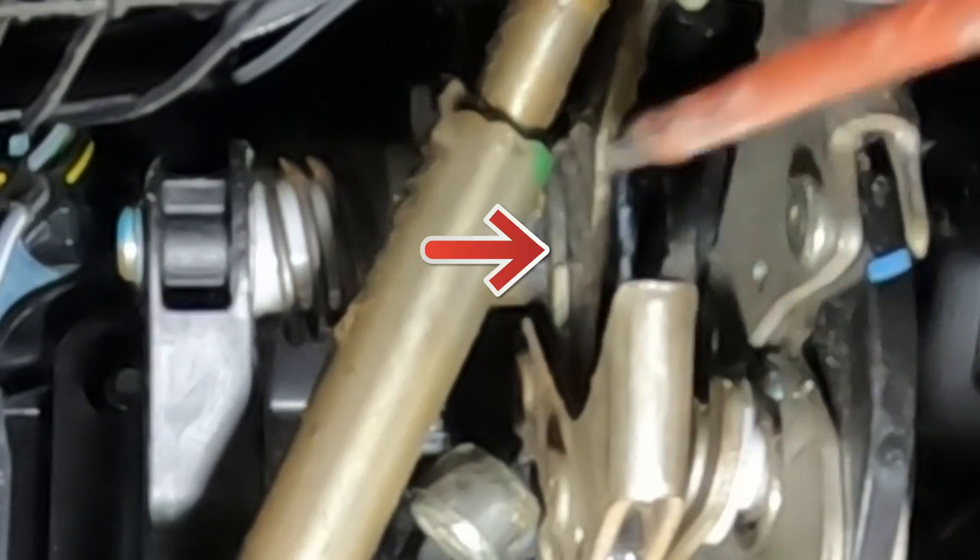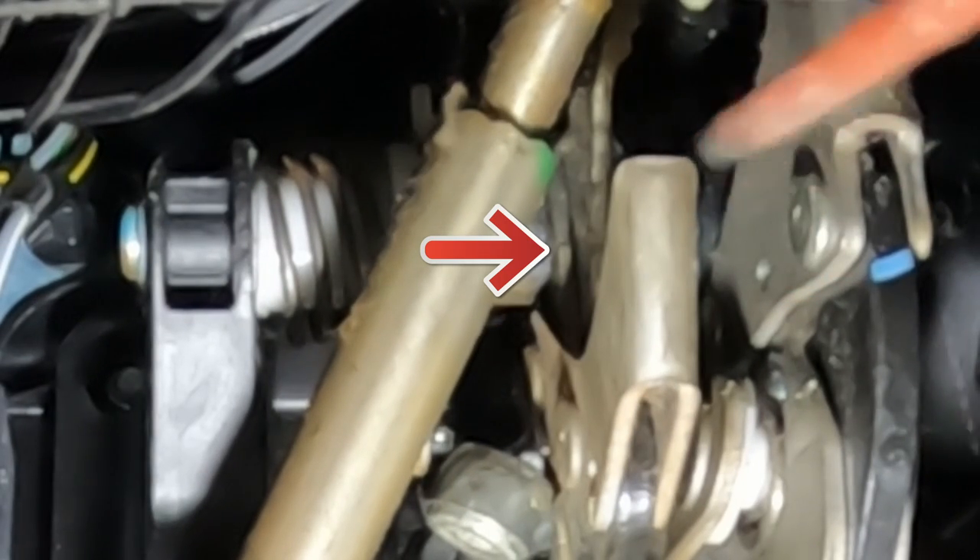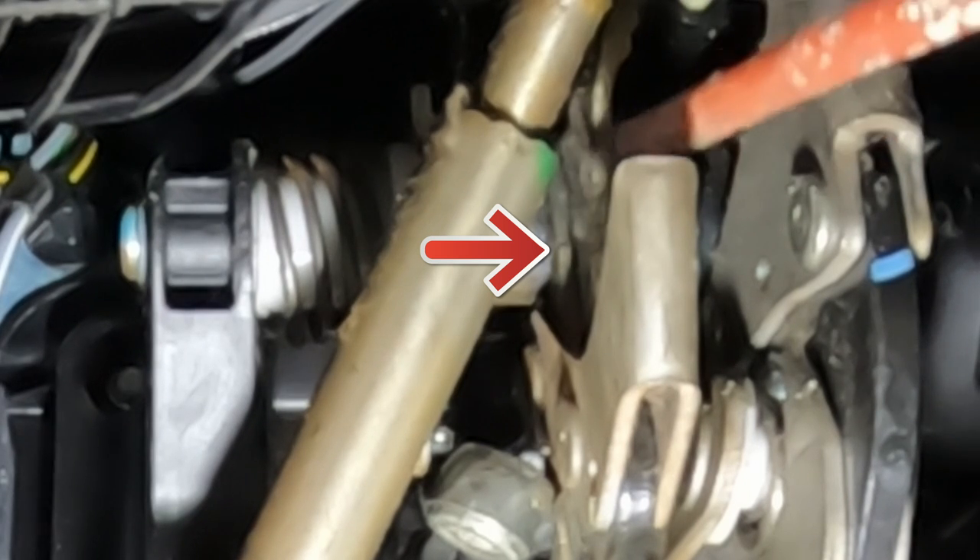If you have a look up here, you can see where the bottom and top part has sheared there, and the weld only comes to this part. You could weld that up if you could take it all off. You've got to be a bit careful because these things have been engineered and designed to have a fatigue point. They will break under certain stress — you don't want it too rigid because you'd end up breaking your feet in an accident. But if I move my screwdriver and manipulate it, keeping this pedal from slipping towards the brake pedal, you can see the join is now together.